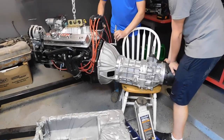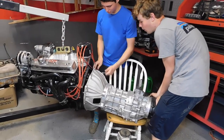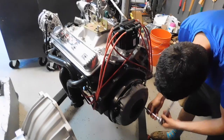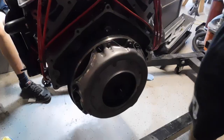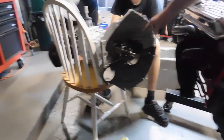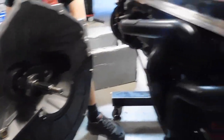Let's think about the physics here — it's just going to go down, the engine is going to swing that way. Here we are with the engine, getting the clutch bolted on, and soon enough the transmission will be on there too. Alright, this is all bolted up and torqued. We got our pilot bearing and our fork on. So we mated her up.